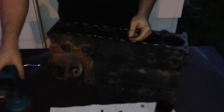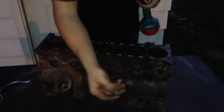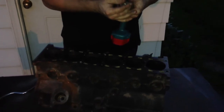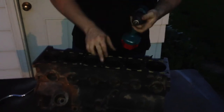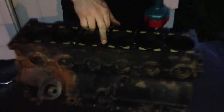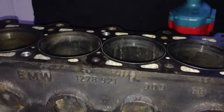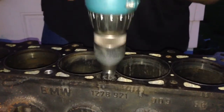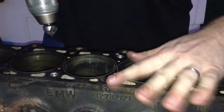Now one last machining step. There's a 45-degree chamfer tool included in the kit. When we re-cut the counterbore on the top of the hole, we made a nice sharp edge there which gets caught on everything and can cut you. So you just take that chamfer bit and spin it in there just for a second or so and break that sharp edge.